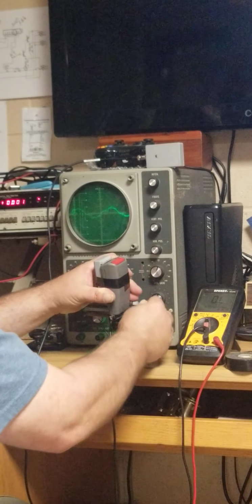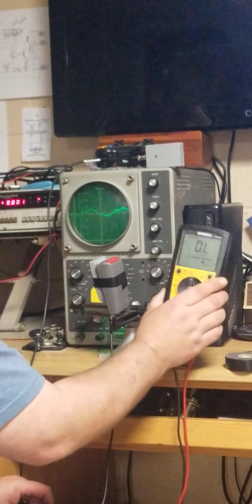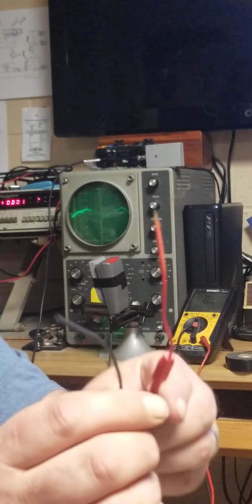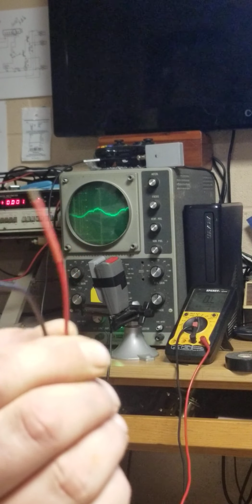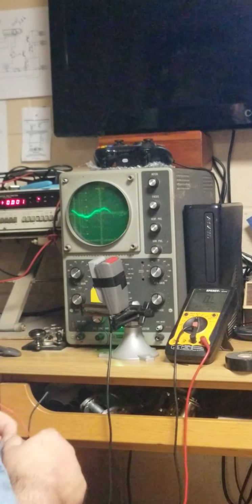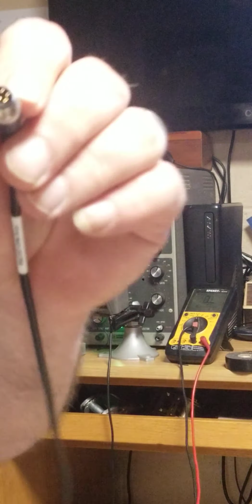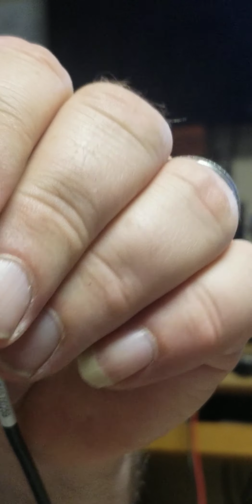In order to set this up, you can use a conventional multimeter with these little tiny pin adapters with little sockets for the pins to go into. This cable is outfitted with an M8 5-pin connector.